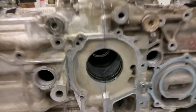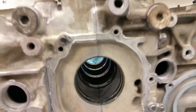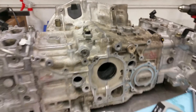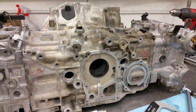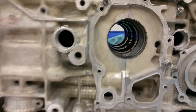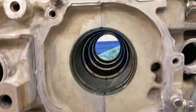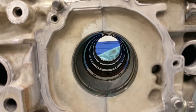Basically what we're trying to do is we have a brand new set of bearings inside the block. We're trying to simulate the engine completely assembled with the heads torqued onto the block. The case bolts are also torqued to spec, but no crankshaft or rotating assembly in the block. The reason why we do this is because the only way to know if the main line on a Subaru is correct — what your measurements are inside here — this is the main line.